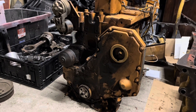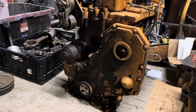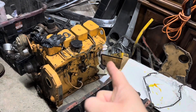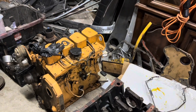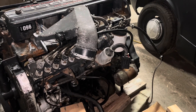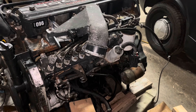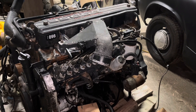This thing has to be here for some reason — I don't know what the reason is yet. I was told it was in some kind of loader, and it did run, so hopefully it's just here because someone really wanted it but then changed their mind. I've only just realized there's no fuel filter, which is fine, but there's also no fuel filter to get a number off of. It's important to keep another engine around when you're putting something together out of a pile of parts. The first Cummins I ever put together was a 1993 D350 Dually, which I bought in baskets. Luckily I had an 89, and although it was not intercooled, it was close enough to kind of show me where everything went.